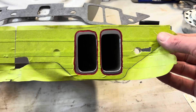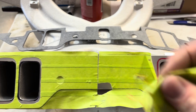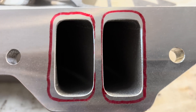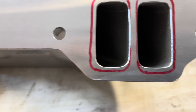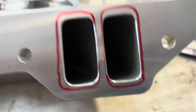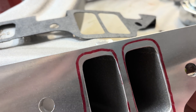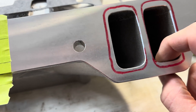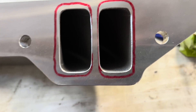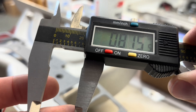We can peel this one off and look. That's got to go to the outer edge of this — all the way to there, if this was a fully ported out scenario. I'm certain it could be gasket matched, but I want to check the thickness of the roof of this intake right here. Let's check that measurement with that pin and we'll subtract in just a second. 815 on that pin. Find an edge that's not raised, stick my pin there, then I'll get a measurement on the entire thing.